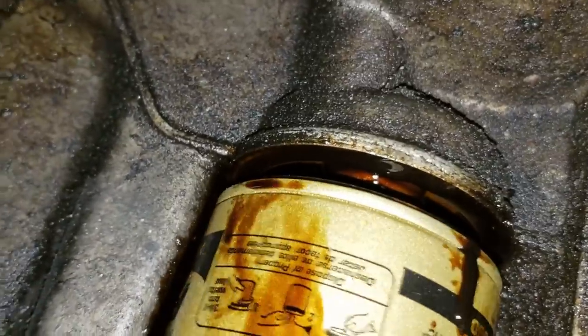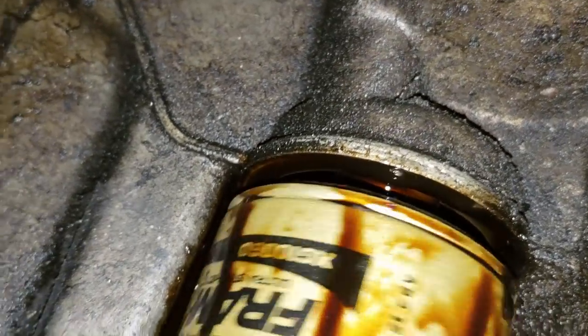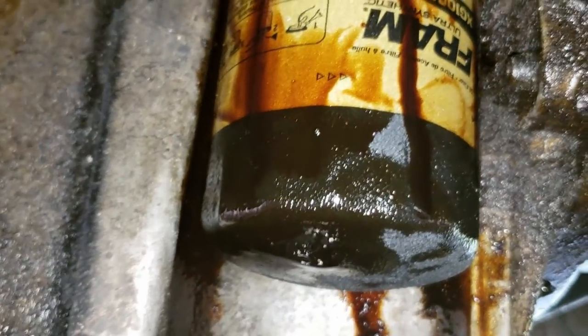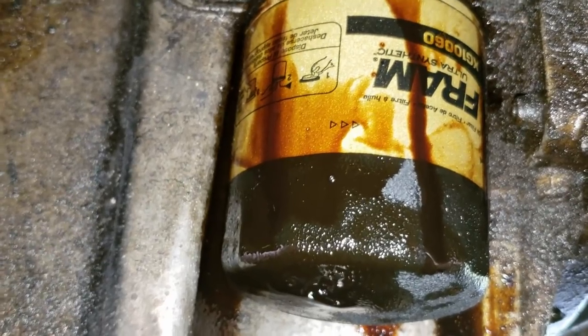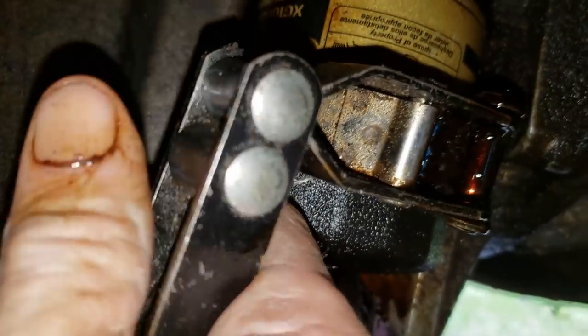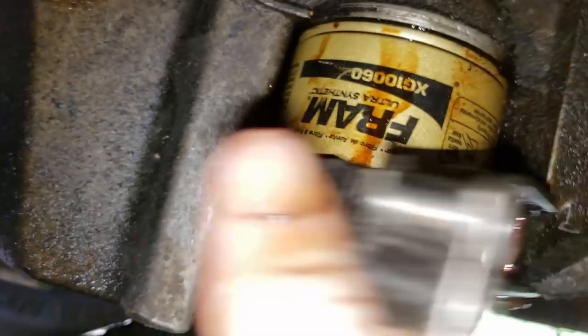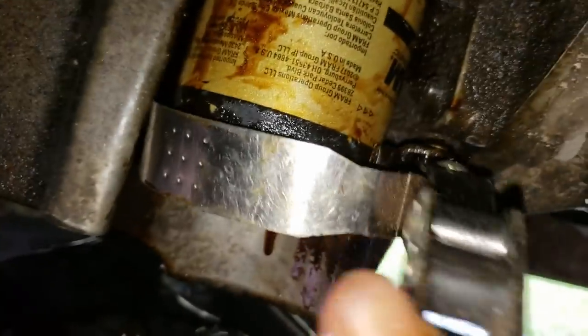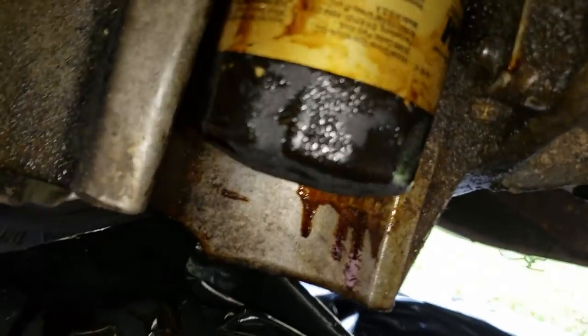Doing it with one hand, so bear with me. We already drained the oil and now we're just screwing the filter on. A lot of people say just put it on hand tight, but I've always used the wrench — give it about a three-quarter turn. It looks like I'm really cranking it, but it's just because the oil filter wrench slips. Get your wrench on there and just snug it a little bit. There we go, that should do it. Clean it off — nice.